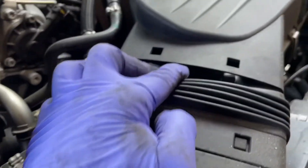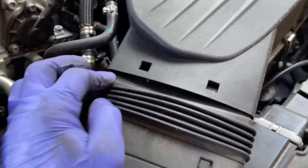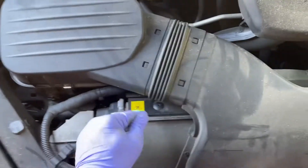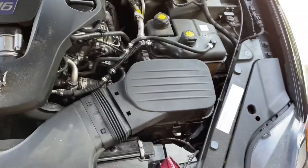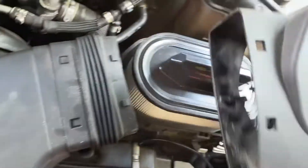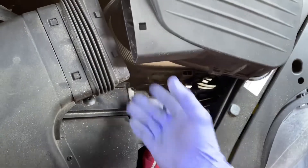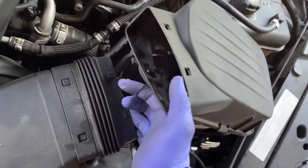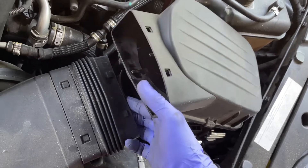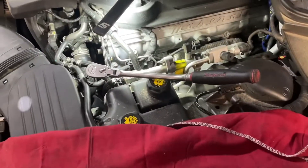I have this in basically the same way. On this side I noticed there's a little plastic piece — I can't really see it on camera — but it's got to go under here and sit flush. I need to go back and fix that. For the most part the air filter is done. Let me show you that little plastic piece: you see those on top and bottom — this piece needs to sit in between those two so it sits evenly flush. I'll fix that real quick, then we'll get to the oil change.